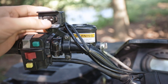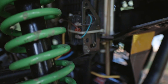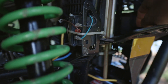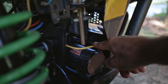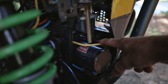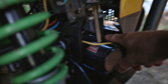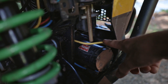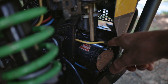If you're having an issue, check the solenoid and make sure all your connections are good. Check at the battery — make sure your battery terminals are tight; I like to use a wrench to get those tight. Then come up here to the winch. You can put 12 volts directly to it to test it. You may need to put it in freewheel and pull the winch line out a little bit to have cable slack, then apply battery voltage to the winch motor to test in or out.